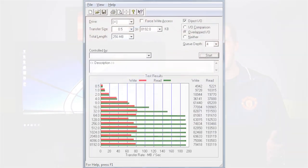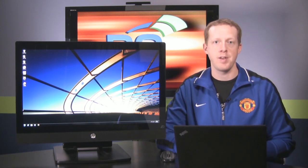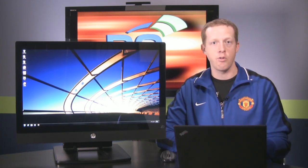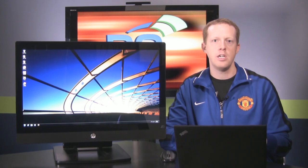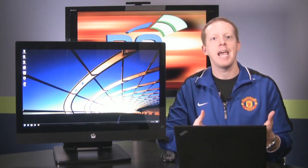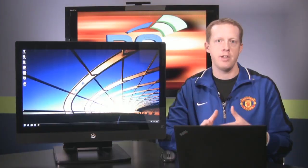With the storage, the Intel 320 300 GB SSD ran very quickly — 190 to 195 megabytes per second in our benchmarking. It is a SATA 2 or SATA 3G device, so it's not maxing out specifications like some more recent SSDs, but in terms of keeping the system fast and responsive it does a very good job. Looking at the Quadro graphics, the 3000M is this particular model — a Fermi based design with 240 CUDA cores, putting it between a GTX 560 and 550 on the consumer side. Clock speeds are a little lower than usual due to the 75-watt TDP constraint of the MXM module. You won't be gaming at super high resolutions on the 2560 by 1440 panel, but for AutoCAD, 3D modeling, and professional workstation tasks, the 3000M will be more than competent.